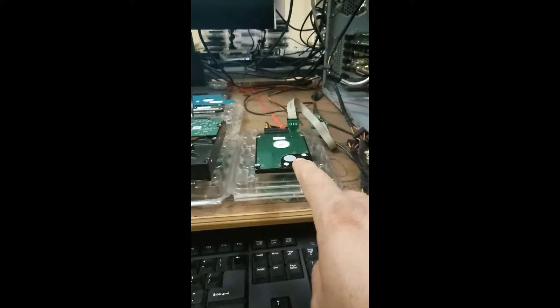Before this step I inspected the PCB for short circuits and did general cleaning. The next step in this recovery is to take another 500 GB hard drive and put it on the destination port of the tool, so we can clone all the good readable sectors from the defective drive into that destination drive. Once that's done, we grab the data from the clone and transfer it to a third drive. I'm still working on the negative cylinders — the SA area — and once that's done I'll show you the next step.